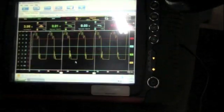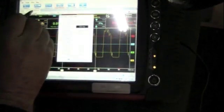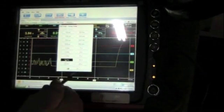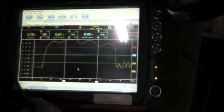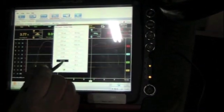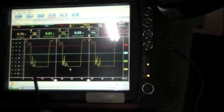Change my trace to 100 milliseconds — you can see it again, we've got a lot of dropouts. Now if you were looking at 500 milliseconds, it would look like that. Going back to the original preset, it was 10 milliseconds — you can't see it; there's one long dropout there. That's why it's easy sometimes to go to more milliseconds, back up to 50 — it gives you a better picture, and you can see the dropouts very clearly. So now we've got evidence that the fuel pump is bad. Electrically it is bad. If it's bad electrically, it can't be good mechanically. We're going to change the fuel pump and then come back and show you the same vehicle with a good fuel pump and what good waveforms should look like.